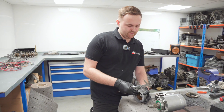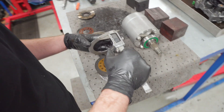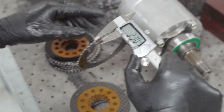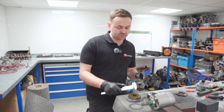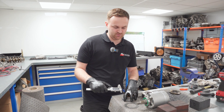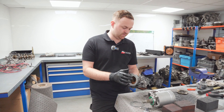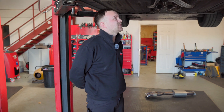And that's not just because it's got an extra plate in there either. If you measure one of these steels you'll find 1.8 mm, whereas a factory steel will be thicker at 2.3 mm. What they do to accommodate the extra plate is put in slightly thinner steels to allow for it. The reason they do this as an upgrade is that on higher power cars it stops four-wheel drive slip, because you can end up throwing too much torque through this. But for this application it's a good replacement for worn clutches.